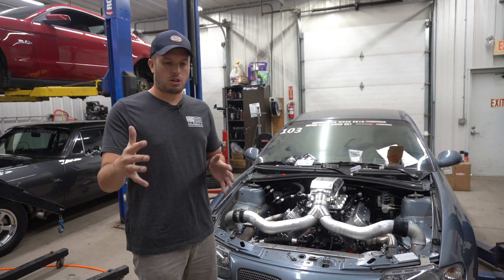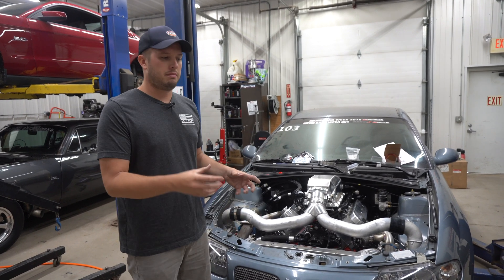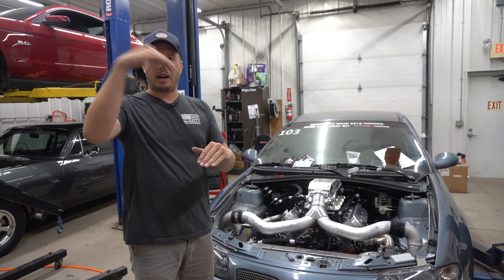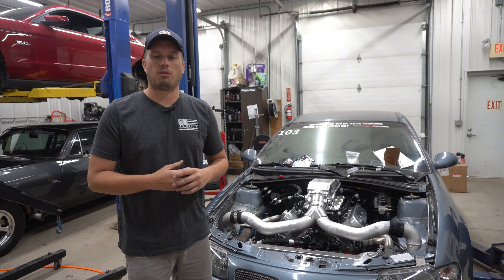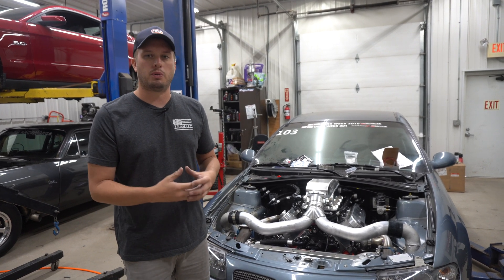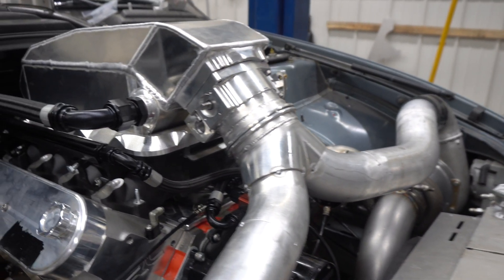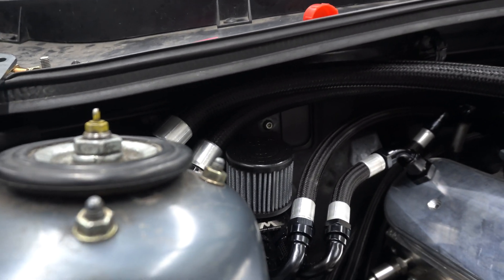This is a great alternative if you're building your first combo and it's in a decent horsepower range that an air-to-air intercooler can't handle. Definitely look at these air-to-water intercoolers — less piping and less bends means more horsepower, and it simplifies the overall combo. The basic concept is it's an intercooler where water goes in through the core and cools it, and then air passes through it, basically just like a radiator, but we're putting ice water in it to ultra-cool that air charge. We made this piping in a couple of hours and it should be all done and ready to go.